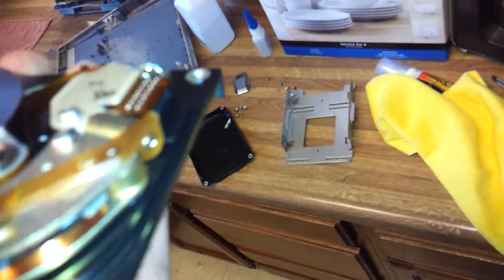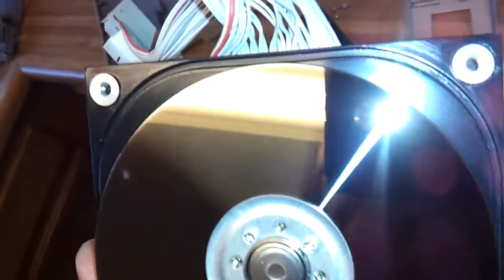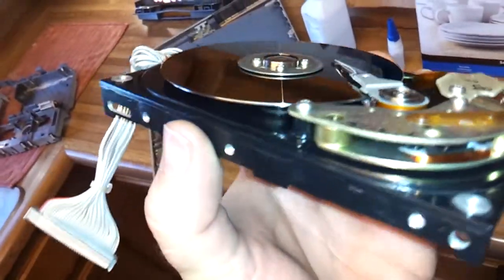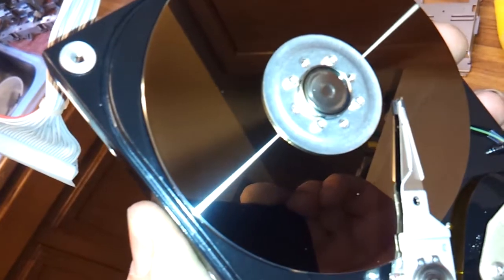I took a microfiber and used the tip of my fingernail. You will need fingernails or some kind of flat blade, and there's still a little bit of residue I can't get it all out. Just take your fingernail or a flat blade wedge tool and very carefully clean all that out first, then put a little bit of alcohol on a new microfiber cloth and go around again. Do not touch the platter because these come real close to the borders — do not touch the platter under any circumstances. If you do, you might as well stop now and throw the drive in the garbage. Same thing goes for fingerprints, anything. A little speck of dust here and there is fine — there is a catch in the drive lid to catch all the dirt anyway. Just make sure there's no large chunks in there and you can blow it with your breath if you have to.